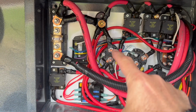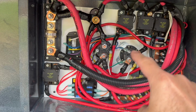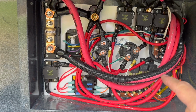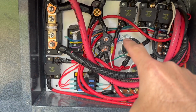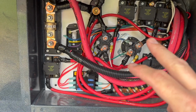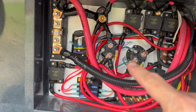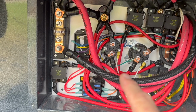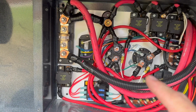And when you hit this relay, somehow it's 12.8 volts and then 4 volts. And then this relay, this wire right here, found out it goes to the chassis battery, or for the engine starter. And then the relay is controlled by this blue wire that comes over to this Bird 909. And so basically, because it daisy chained around, you have the house battery here and your chassis battery here. So when you turn your ignition on and the truck's running, then basically the alternator will push charge back into the house battery.